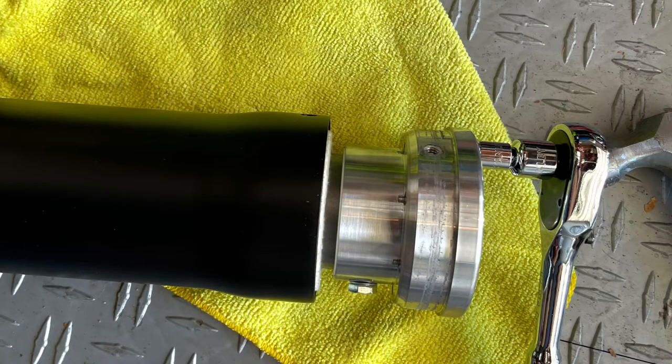Just to clarify, you don't actually have to take off those bolts that are on top of the insert. Those bolts are purely decorative. But you can see the setup that I had here. I was basically using one of those bolts on the insert to rotate the insert while holding down on the slip-on. On the slip-on where it bolts onto your exhaust system, I put an Allen key in there to give me some grip, and then I was turning the wrench off that insert so that I could twist off the insert.